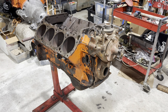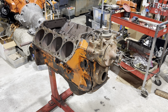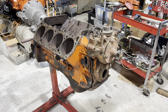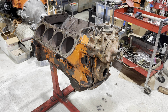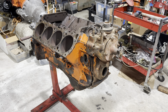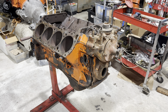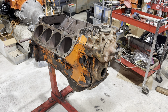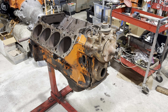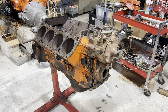I can't tell you how many times, hundreds and hundreds of times, I go on the Mopar message boards and everybody says, 'I've got a 440 motor, but it's a six-pack. How do I prove it's a six-pack motor?' Well, the short answer is the blocks are the same. A 1970 440 HP U-code 375 horse motor and a V-code 390 horse 440 six-barrel or six-pack - there is no difference in the block.